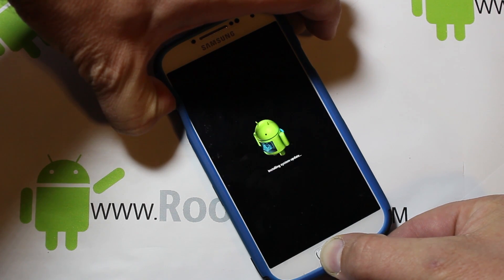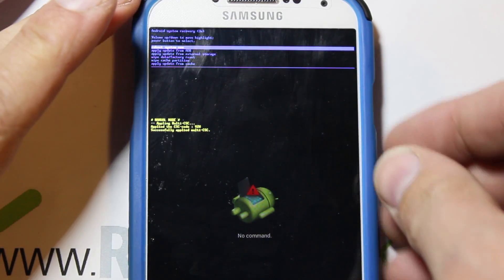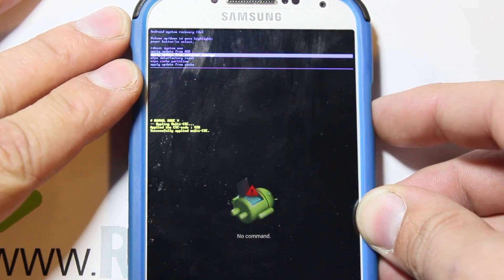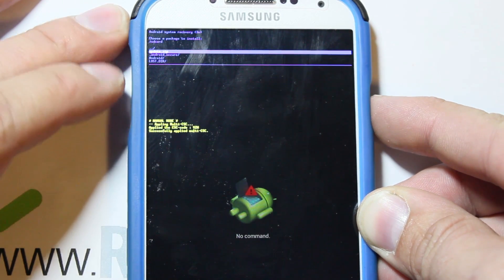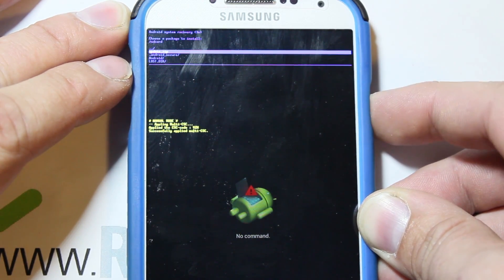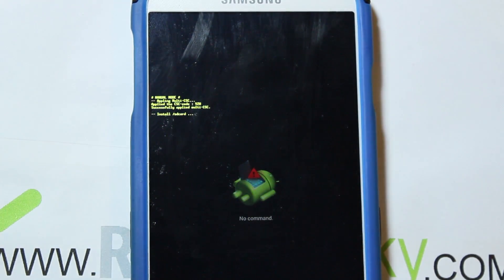My screen says 'Custom' just because I've messed with it too much. Now you're into recovery. The recovery options are: reboot system now, ADB, and 'apply update from external storage' — that's the one we want. Select it with the Power button; you scroll with Volume Up and Down. Navigate through the file system until you find the update zip — mine's right at the top — and select it with the Power button. This is going to go through the whole update process and it's a 600 MB update, so it's a very large file.